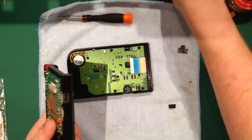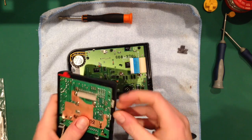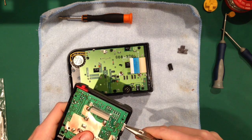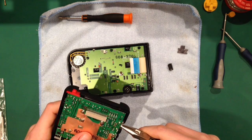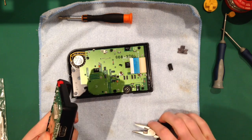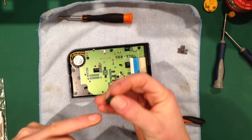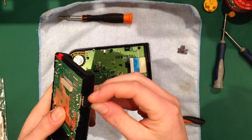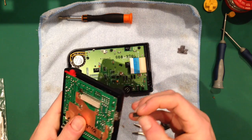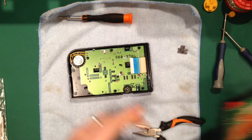No, I thought I'd need these. So if ever your port cover won't stay in properly, it's quite loose, the best thing to do is, very gently, take your pliers and push these covers down like that, and you see it'll square it up. And then that little tooth there, I don't know if you can see, but that little tooth is just going to sit in the slot in there. Oh, whoops, in the bottom, sorry. So I'll pop that in there, so that won't come out as easy now.